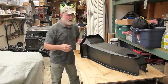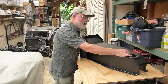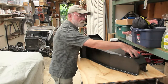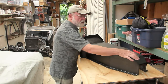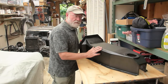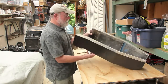In the earlier shot when I showed the raw mat board, there was a gray circle here. For the gear shift air excluder mount, I took a piece of aluminum and stuck it right in there, glued with the same polyester resin. That gives me a place to mount the screws which will hold the chrome finisher ring. I also used a plastic filler product — not Bondo brand but that type — to make it a little smoother and get rid of some of the rough texture from the fiberglass layup.